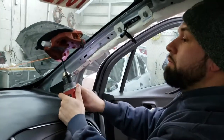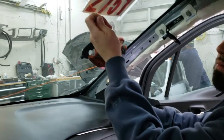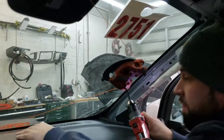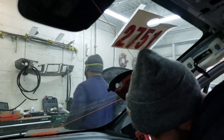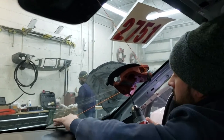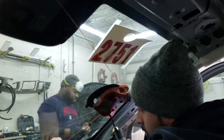There are different size lines for R&I or just getting the glass out. The thinnest I know of is the x96. So far we haven't had any issues removing a windshield without causing damage. I really feel like it's the speed that you remove the windshield. I'm going to always stress patience — I'm not a very patient guy, but when we're doing glass work I try to be as patient as possible, because that's when things start to go bad. If it's already broke, you can full send, but you've got to watch out — that's how you damage the pinch weld.